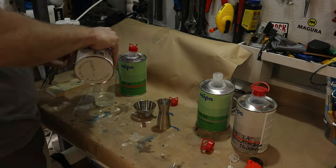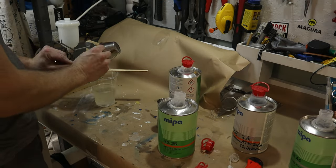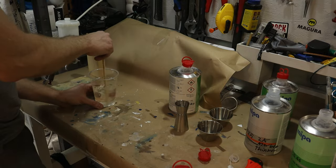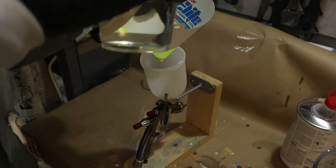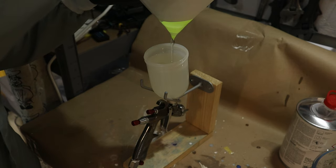All paint is laid down and it's time to mix the clear coat. The metal flakes are thicker than regular paint, so to create a perfectly flat top coat I need to bury the flakes in several layers of clear coat. In this case I lay down seven coats with five minutes in between.